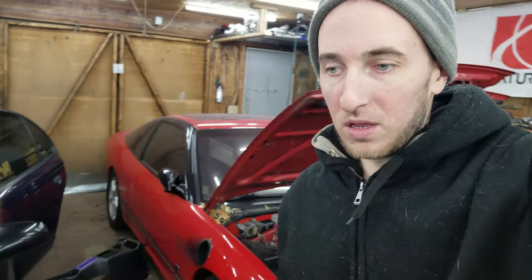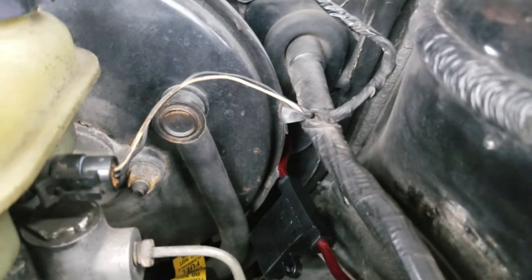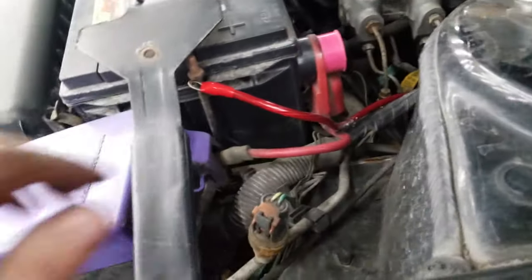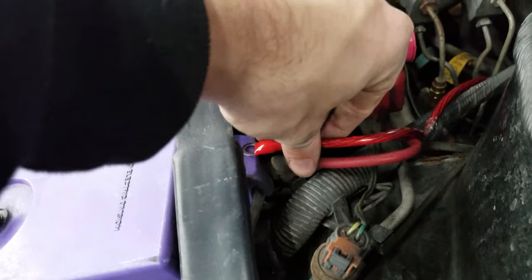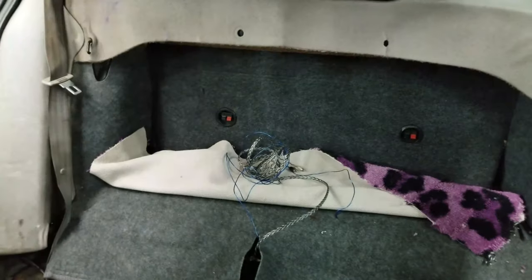Next thing to do is the subs - now the fun part begins. We just got the power wire ran for the amp. The best way to do it on these cars, especially being an automatic, is I normally take out the plug where the shift center would go - since it's an automatic it doesn't have one - so I drill a hole through that rubber grommet, run the wire right up through there into the fuse box. Then on the inside I run it up over and under the carpet, and they go up to the rear speakers.